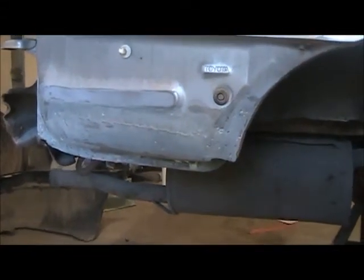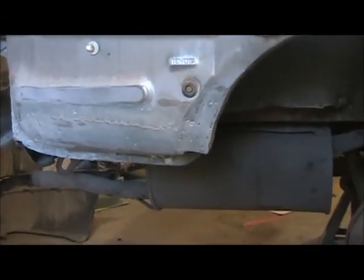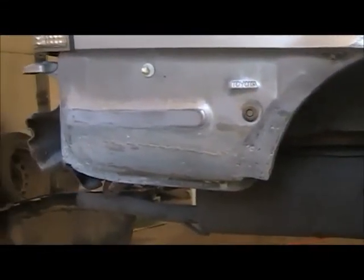I got that back piece all back together, welded it solid and then a skim of fiberglass on it. Not going to be too fussy with how smooth it is, same down here. I still got to do the seam seal — I got to seam seal along underneath, in behind the rocker, along that edge down in there.